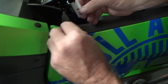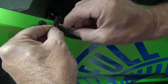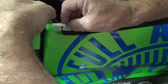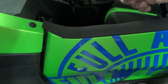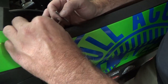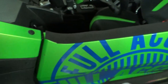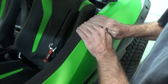So before I officially stick it down — it's super hard to make a good cut because you can't really truly see it. I forgot to cut the edge. For me I'm just being super careful because we have a vinyl wrap on here and I don't want to cut into the wrap, but you can put it down and cut against your door if you want to. So once you've done that just kind of firmly push down, get it to sit, and then you can start rolling over the other edges.